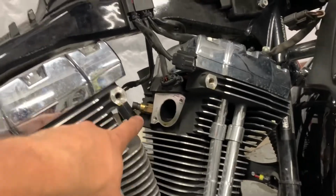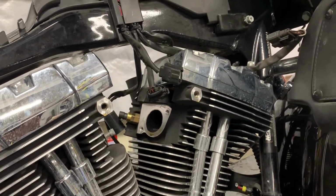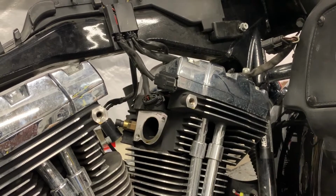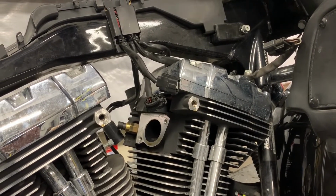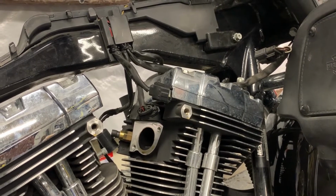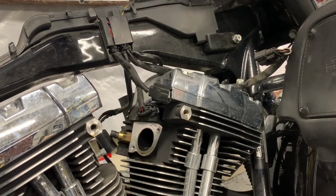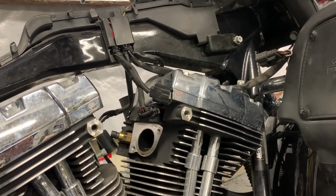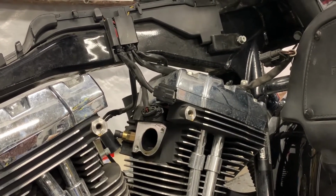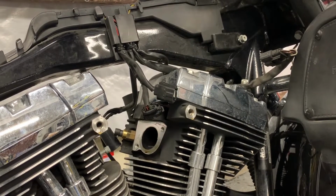It looked like I might have had to pull out the cylinder temperature sensor over there. That looked like it was a 13/16 size socket. The socket's a little bit long, so if you wanted to take it out with it in place, for this deep well socket I had, I was probably going to have to shorten it a bit using my grinder. But I think what I'm probably going to do is just plan to take that sensor out and put it into the new cylinder before I install the thing on the bike.